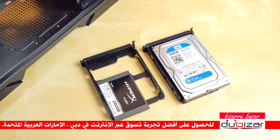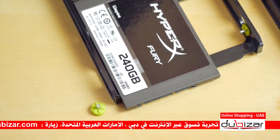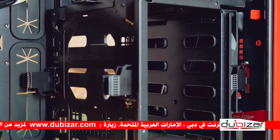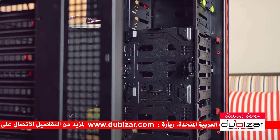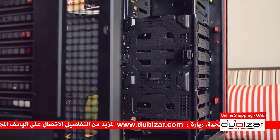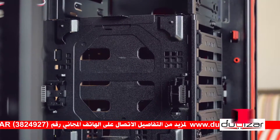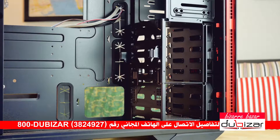The hard drive cage can support up to eight units toolless — mechanical and side SSD mounts — so one of the corner pegs will have to come out, which is a bit annoying. Look at just how blocked that drive cage is. I'm surprised this actually passed through testing, because there will be almost zero airflow coming in from the front. A bracket to house an additional 120 or 140mm fan won't do much as the fan won't breathe at all.